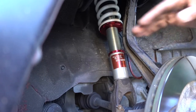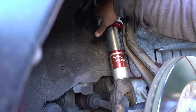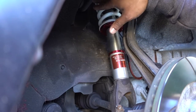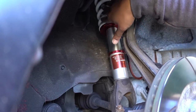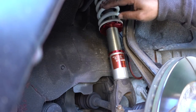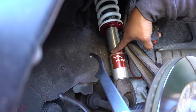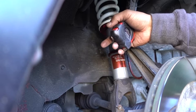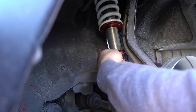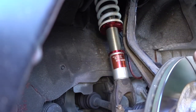The good thing about coilovers is you have the chance to adjust the ride height. In this case with the coilovers from Truhart Street Plus, I'm not gonna be able to adjust damping and rebound, but I'm gonna be able to adjust the height. The preload on the spring is already set from the factory — you don't have to adjust the tension on the spring. The kit came with two wrenches: the small one is for the bottom collar, the big one is for the ones on top. You just have to adjust the one on the bottom with the small wrench. I'm gonna get the bottom collar loose so I'm gonna be able to move the whole strut, which gives me the adjustability I'm looking for.